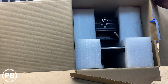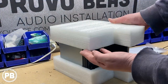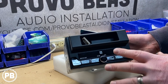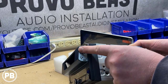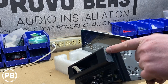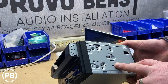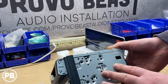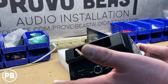What's left in the box is the radio itself. We have the screen on the side as well as the main double-din chassis, and it also comes with a remote. The chassis has no screen per se — it's just the brain — because the screen is separate. This bracket sticks out quite far and is what you'll mount the screen to. The harness connects to the input on the back of the screen. Keep in mind the screen will stick up, so if you have vents above your radio, it may block them.